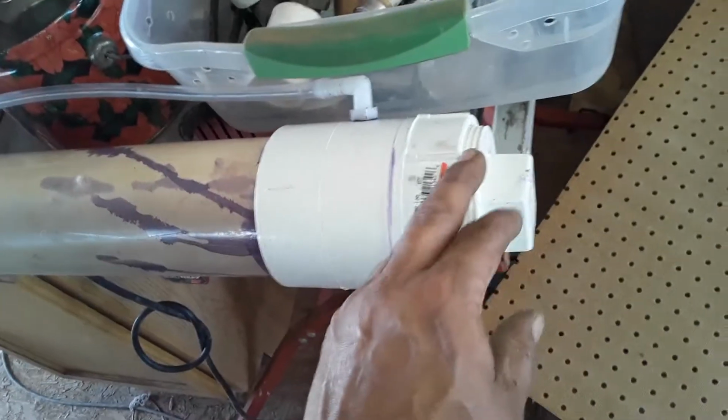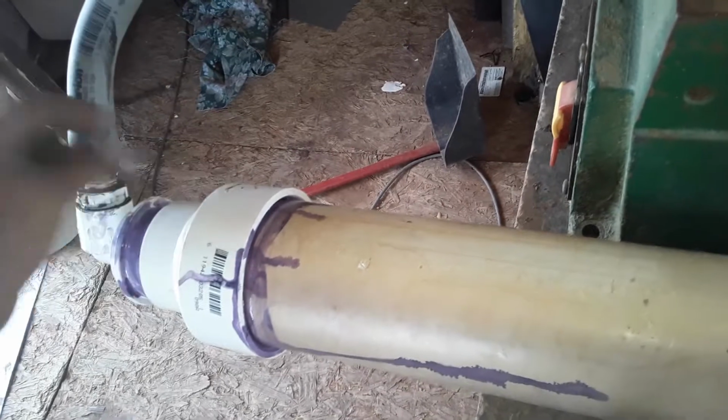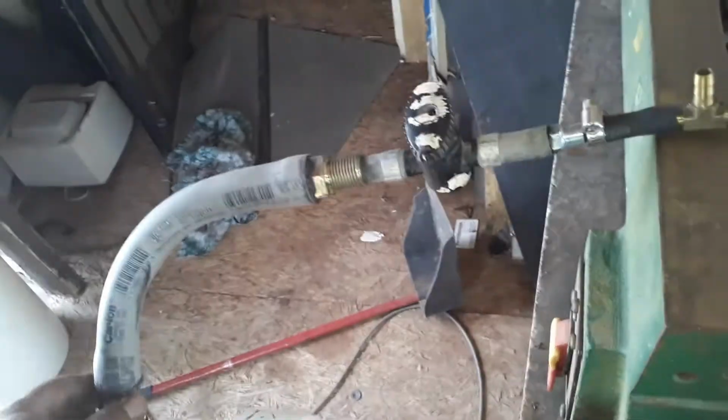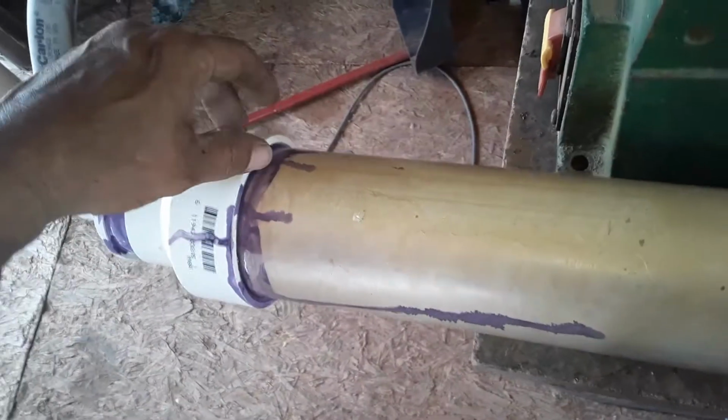This is kind of important. You got to have this part, so you're going to have to buy this part. But you could simply just put a cap on the end and then screw a hole here on the end, and then either put that in there or straight go with whatever. You could even screw a regular garden hose type whatever. You just need to have a gate valve coming out of here, and then over here have your fitting.